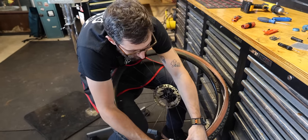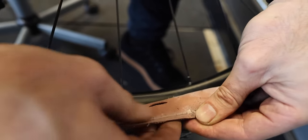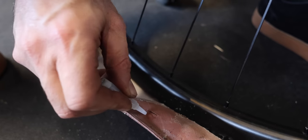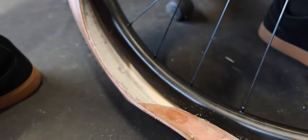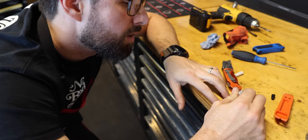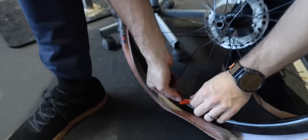Use your fingers as well — if there's dried sealant, rubbing your hand on it will actually get it off from around the cut. Don't rush this because if you don't do this properly you're not getting home. Get your patch and add some glue to it — don't be shy with the glue. Press the patch down and make sure you cover the whole cut.